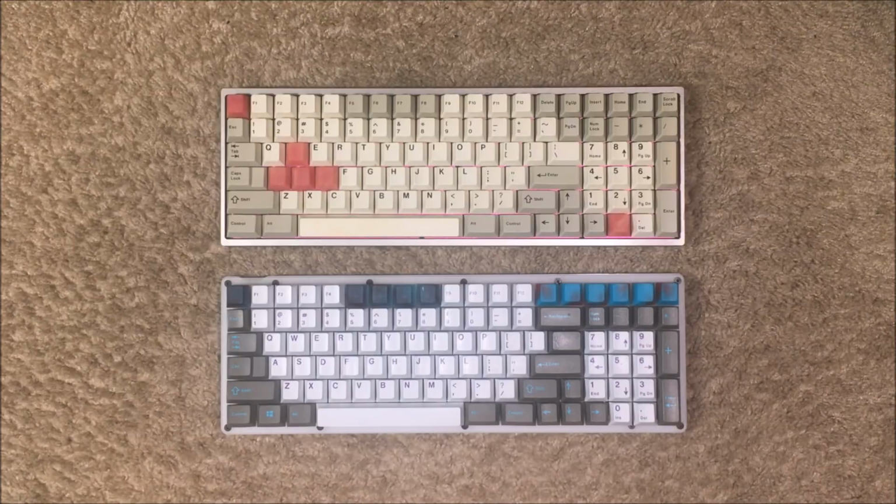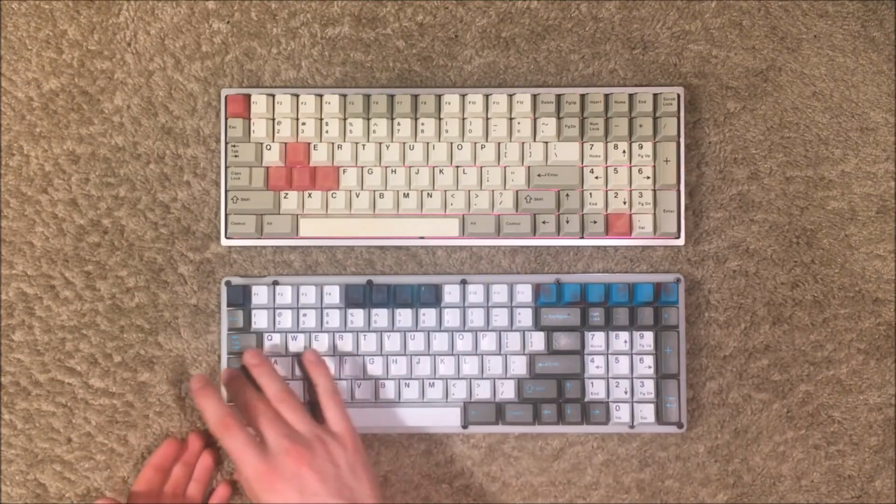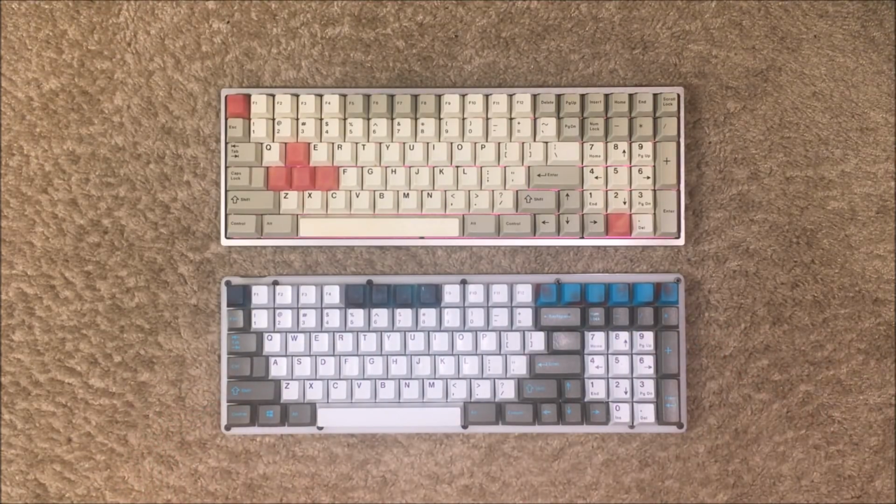So another thing to mention about this keyboard is it has the Win Keyless Boot Mapper programmable PCB, but the biggest drawback, which was the reason why these were sold at cheap pricing, is because only the back row of LEDs work on the RGB and not the front row of 12 RGB LEDs. So the keyboard doesn't illuminate perfectly evenly. But I'm not a big person of RGB LEDs in general, and the color still looks fine, and you can still pick any RGB color you want, all whatever 12 million. So it's more than enough, I think.